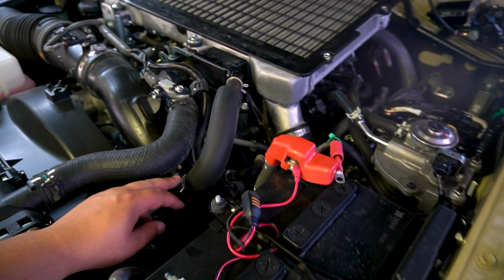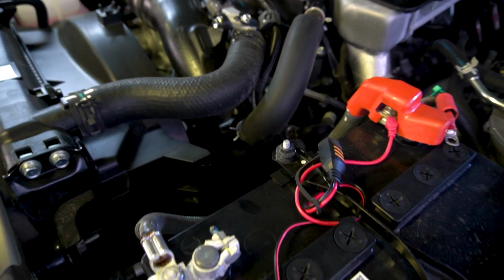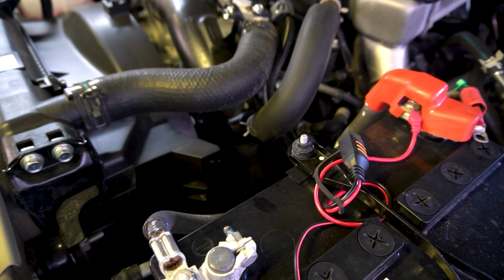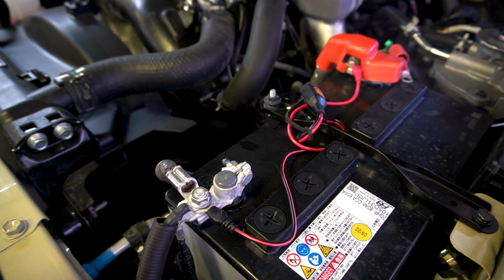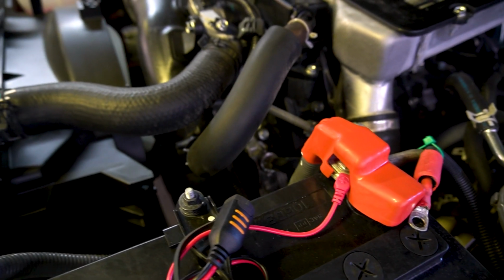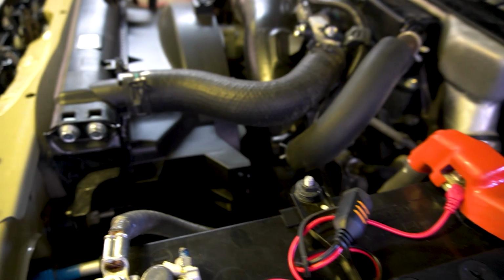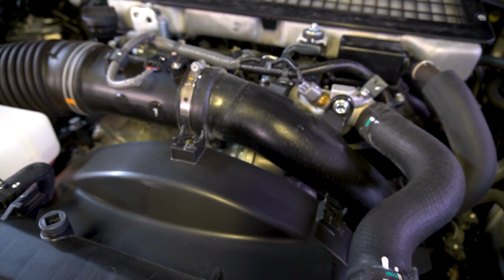So with these oil breather gases running from the crankcase ventilation back into the intake system, what that does over time is cake up the intake system with all this sort of oil sludge and deposits, and what that will do is highly restrict your intake so that your engine basically isn't getting as much air as it should be. And that can also block up your intercooler with oil particles, all of that sort of thing, and just clog up your whole intake system. So it's good practice to run that through a filter so that all of that doesn't happen and restrict your airflow, which could eventually result in catastrophic damage to your engine.